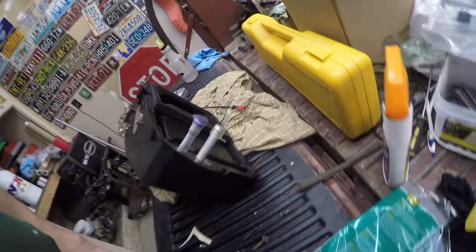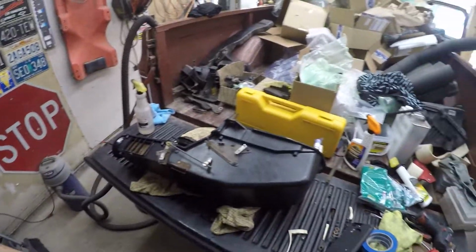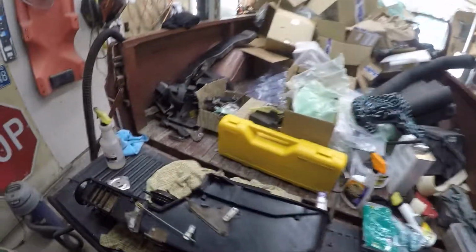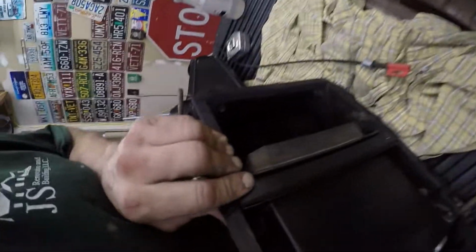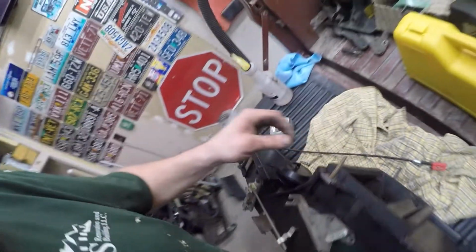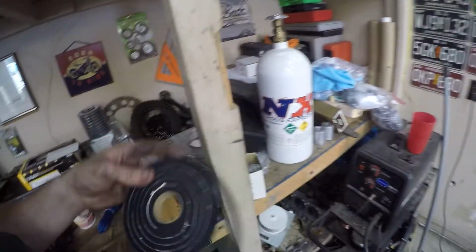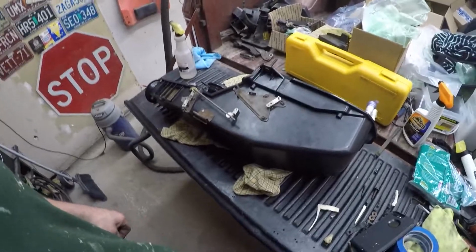As far as that goes, the heater core's back in. We're going to stick the box in and finish running our heater hoses. And then we can dress everything else up after that. I put this foam to replace what was there previously. It's this roll. It's 1/2 inch wide, 3/8 of an inch thick, and it should be plenty good. So, time to reinstall this dude.